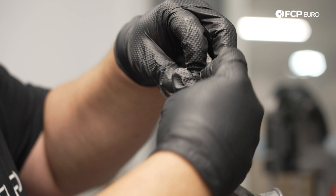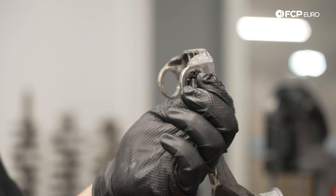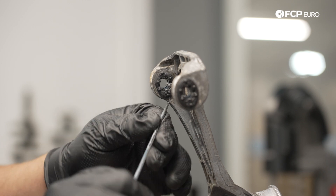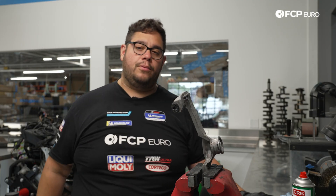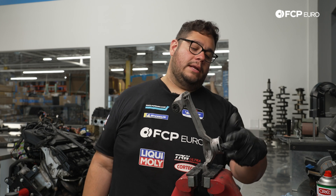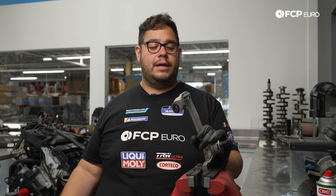We'll try going in dry with a little bit of brake cleaner — brake cleaner kind of acts as a lubricant to help pop the new bushings in. We're pulling the little lip out to seat them. Now we'll grab the shift lever, get the new ball bearing bushing, pop those in together as one piece, then install this back into the tunnel before feeding the transmission back in.